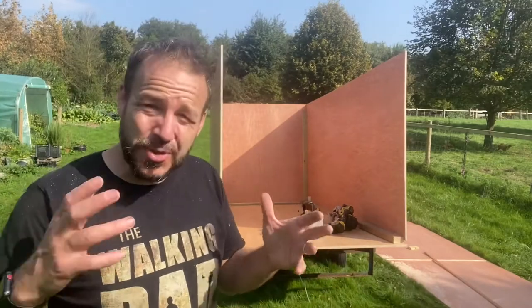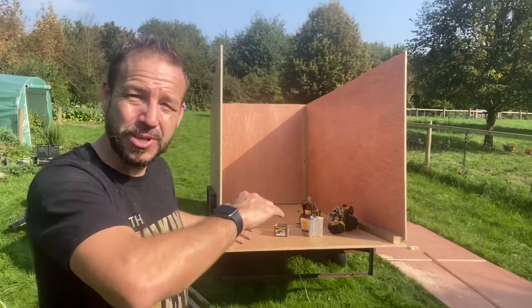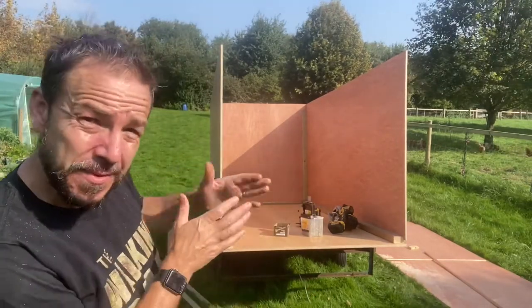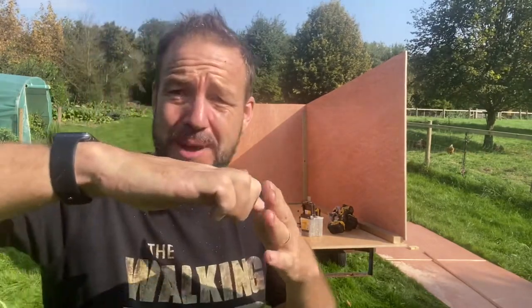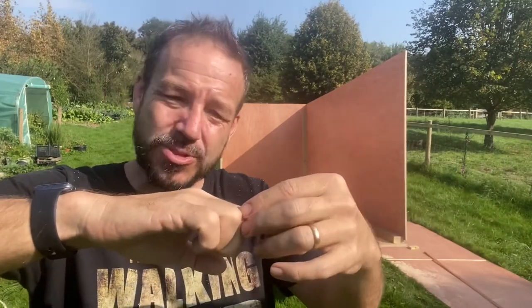Because the trailer is so much smaller than the last one, I've had to extend it, and there are two byproduct problems I need to solve. First, the weight on the back is going to want to tip it when someone stands on it, so I'll need to build some kind of fold-down leg for transport. Second, I've extended it out the front as well, and when towing around bends it's going to hit the corner of the vehicle, so I may also need to extend the towing arm to give more clearance.